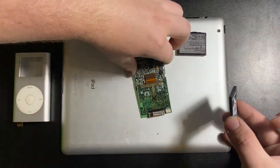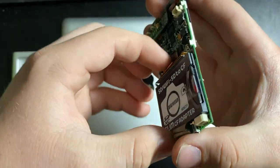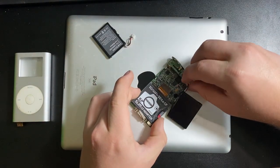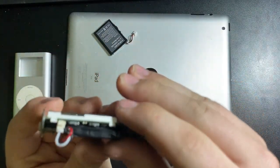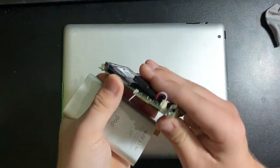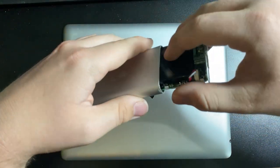With the SD card secured, we're going to go ahead and install it into the iPod main board. All we have to do is slide this connector into all the pins - goes like this. I do it carefully because I don't want to break the ribbon cable. Let's get the battery in - the battery connects right there. Battery is in and we're gonna slide it back into the case. It's smart to do this upside down so the stuff doesn't fall out.